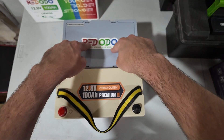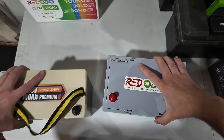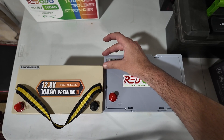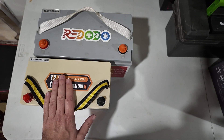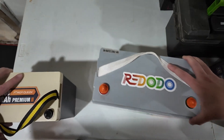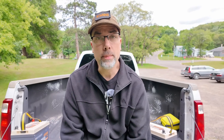The other cool thing about these specific batteries is that they are mini-sized compared to a group 27 or even a group 24 battery. This is a group 24 battery, and this is the Power Queen Mini — you can see they are the same width, but where it gets interesting is in the depth measurement. Putting them side by side, there's about an inch hanging off the backside of the group 24, so the Mini is a bit less deep. Compared to the group 27, the Mini is still a little taller but not as wide and not as deep — great space savings, meaning you can pack more batteries into a smaller space.